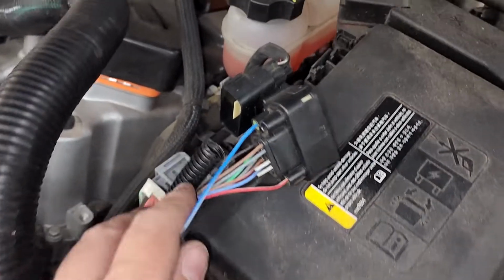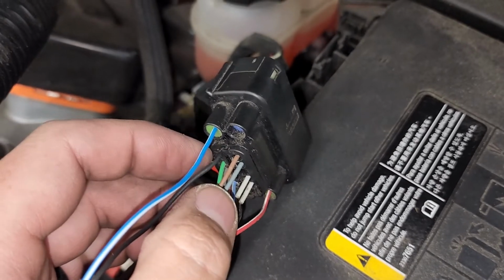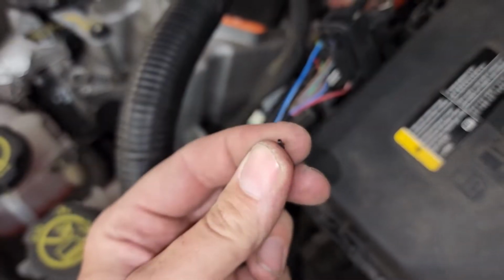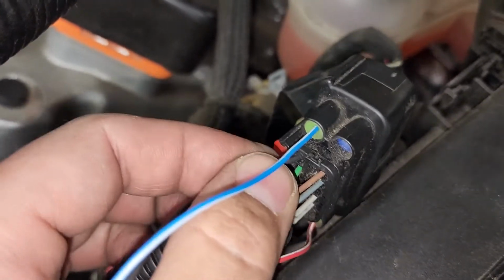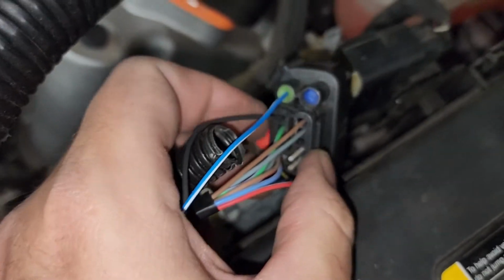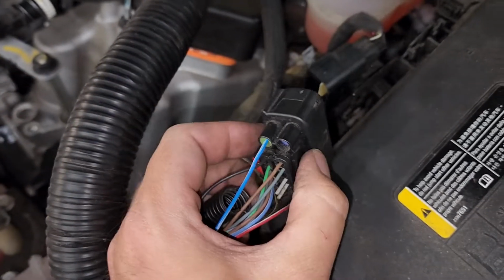Well, instead of rewiring half the car, because the instructions are stupid, I pulled this black section off and then pulled the black plug right here. Yeah, just pull that black plug off of the end of that and just push it straight through. The blue thing on the inside of it is flexible rubber, and you just push it straight through until it clicks, and then push this white section back down to lock everything back in place.